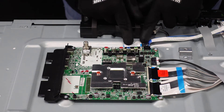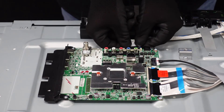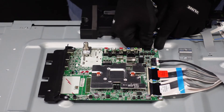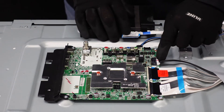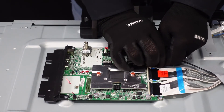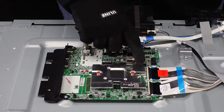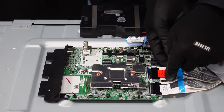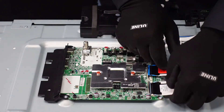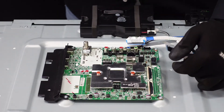Let's go with this ribbon cable first since it's going over the top — flip up the flap and shimmy the ribbon straight out. This next one, pinch down at the top to release that latch and pull it straight out. This clip here, pinch on the sides and pull it directly away from you — use two hands, as these usually give a little grief. Now that it's safely removed, flip up these flaps on the ribbon cables and remove them very gently.